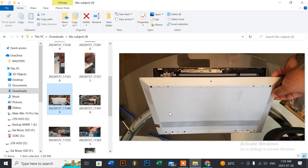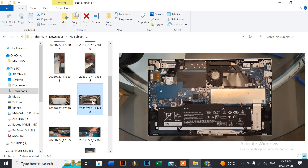You can place your left hand on the corner and use your right hand to lift. There are about four or five tabs along the front. You'll hear a pretty big pop when they release since they're not regular fasteners. Once you've popped them, you can easily remove the panel — no wires are connected from the bottom panel to the laptop, so nothing will snag.